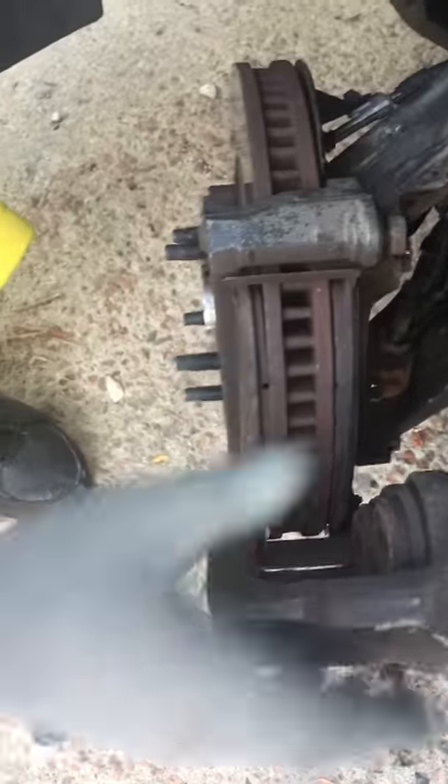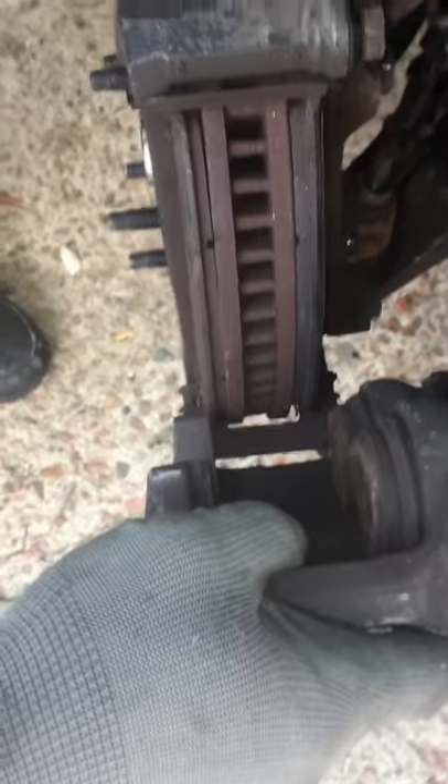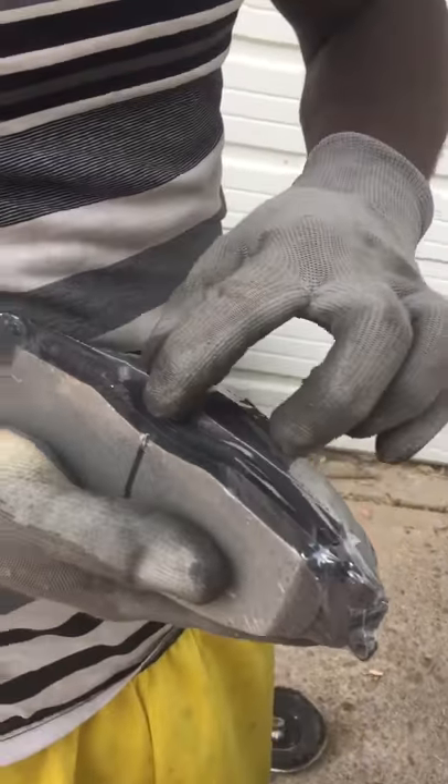You only need to take the front bolt off — the top one. I thought I needed to take both of them off but I don't. It looks like something's leaking. Take these out right here — take this one out, see I barely got any thickness on that. Take that one out, take this one out. I'm trying to see if I have to use my caliper pusher because it looks like I'll be just fine without it.